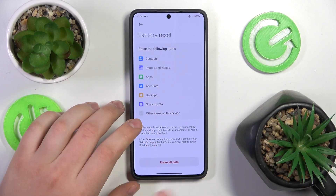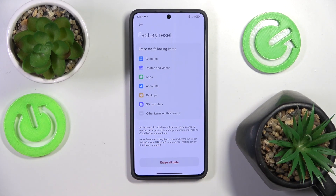Next, make sure that you read all those warnings and make sure that you back up all the important data and files that you have beforehand, since the factory reset is ultimately going to erase all files and data stored on the phone's internal storage. So if you have anything important, make sure to save it somewhere before factory resetting or backing that data up.